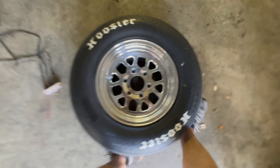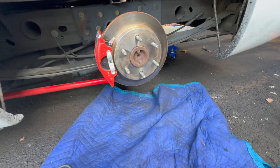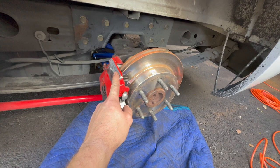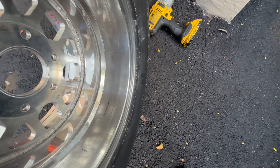Jack dropped this thing off so I can look professional — it's a magnet. So when you're working on the wheel well grinding, no one else's stuff around you gets damaged. I put on my buddy's 15-inch Raystar, which is a six lug, fits the same kind of drag wheel. I have about maybe a quarter inch, maybe an eighth of an inch gap between the actual brake and the wheel. The Raystar is more of a flat profile the whole way through, and this Vogard has a step, which I think is where my issues are rising.